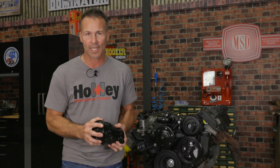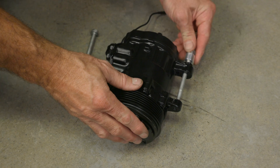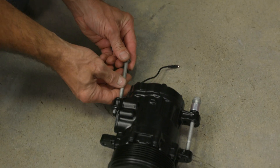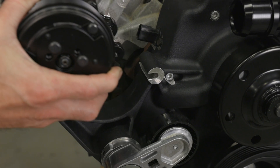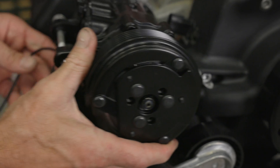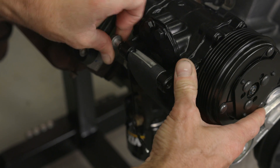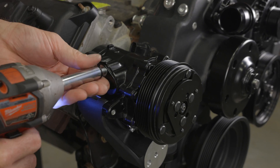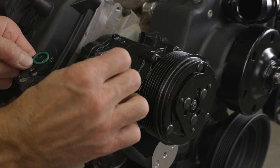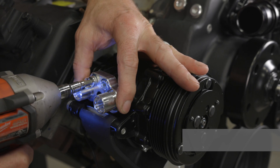We supply a compact and reliable SD7AC compressor to make sure you and your passengers stay cool. You'll need to pre-install the hardware prior to mounting the compressor onto the timing cover. Install the bolt with the head facing the engine and place the spacer between the back mounting tab and the bolt head. The side with the inlet and outlet ports uses the M8x95 bolt — partially install it with the head facing the engine. Position the inside bolt into the slot on the timing cover, then slide the outer bolt out just enough to clear the mounting tab and drop into its slot. Slide both bolts forward, start them by hand, then tighten and torque to 18 foot-pounds. Remove the compressor plate cover, install the included line adapter manifold, ensure the O-rings are seated in the grooves, and secure the manifold with two M8x18 socket head bolts torqued to 18 foot-pounds.